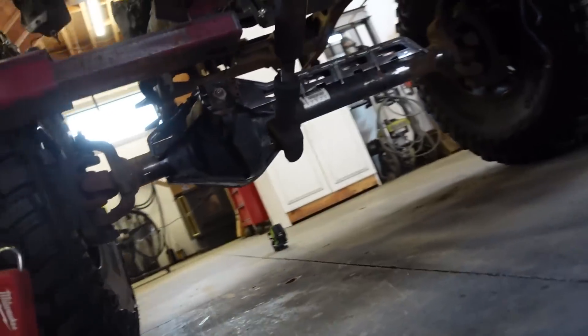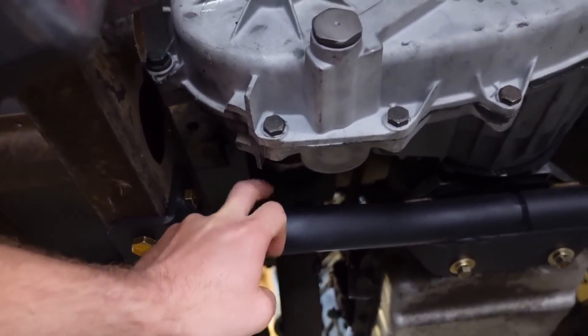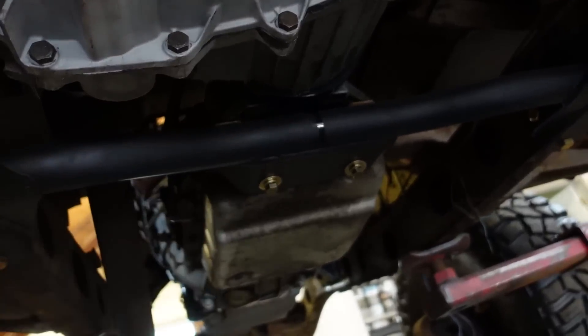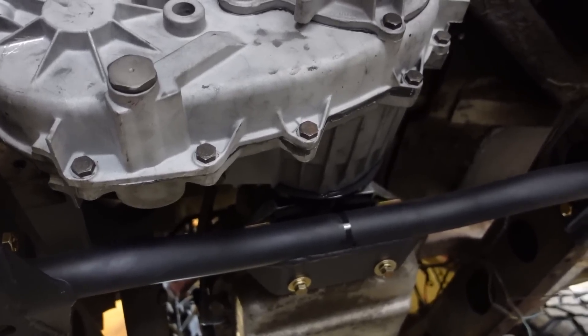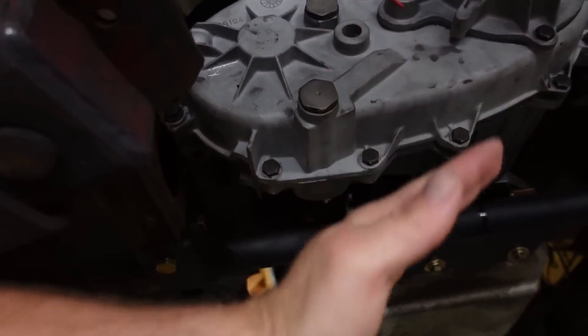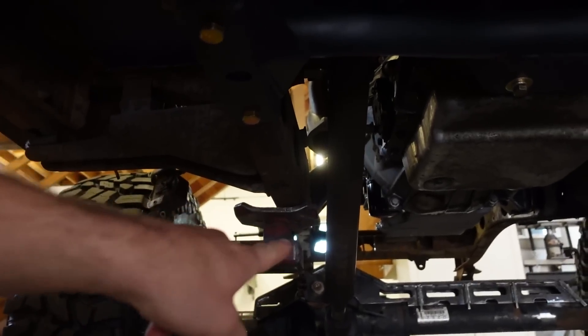What I'm working on now is I'm still fighting this driveline problem. What I'm thinking I'm going to try — I should have just enough clearance that I can drop this transfer case back down to its stock location. For one, this plate is leaking — you can see it's been dripping a little bit. That adapter plate I built was supposed to fix all the leaks, but it's still leaking. And for two, I think just dropping this back down, rotating it back down, is going to help a little bit with driveline issues.